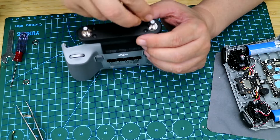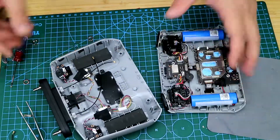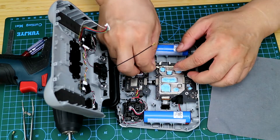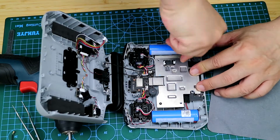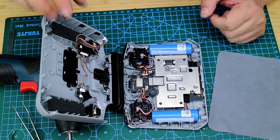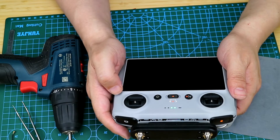Now, after screwing it in, we have to plug it back — and this is how it is. We'd better align the two positions: left to left, right to right, and just put them in. The conductive foam actually does not need to be passed back. In this case, we can cover it back. Let's screw it all back first. Then we plug the socket of the wire back in, and plug this part in too. At this time, we can already check to see if its booting is normal.